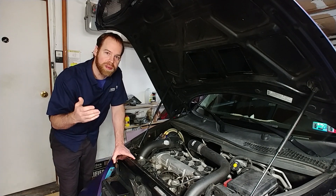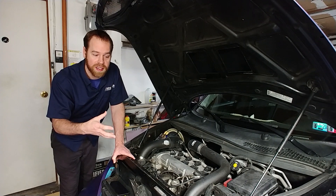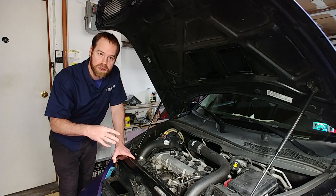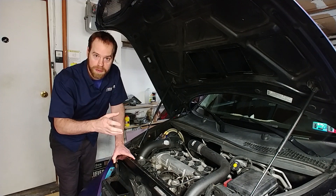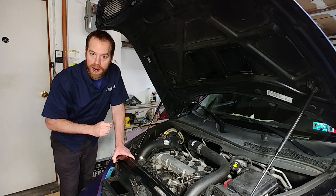So how do we choose the proper size fuse? It's tied to choosing the proper size wire. We choose power wire based off of the demands of the load and how much current we have available. And then we choose the size of the fuse also based off of the demand of that load and how much current can actually flow through that power wire.